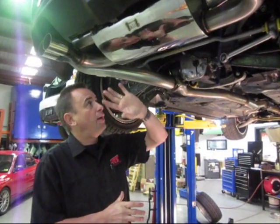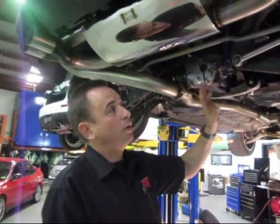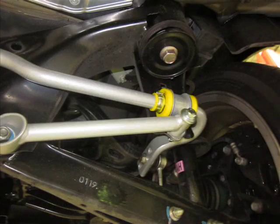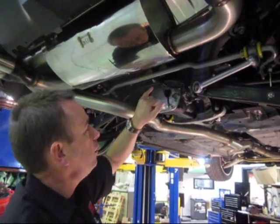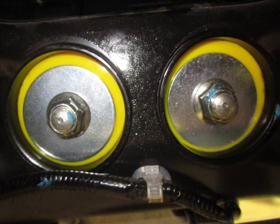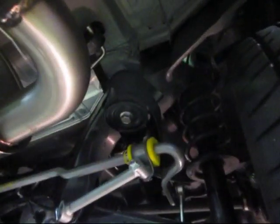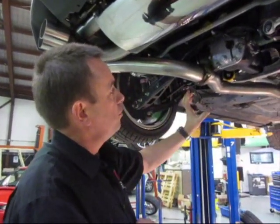The power kit upgrade includes the exhaust, which we'll follow as we move down to the front of the car. For the suspension upgrade, we've fitted an adjustable rear Whiteline sway bar with a stiffening brace, which is critical to stop the bar twisting on its mounts under load. We've also fitted the rear diff mount bushes, which stops the diff moving around on the rear subframe.